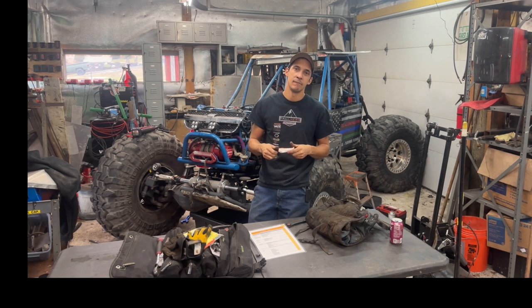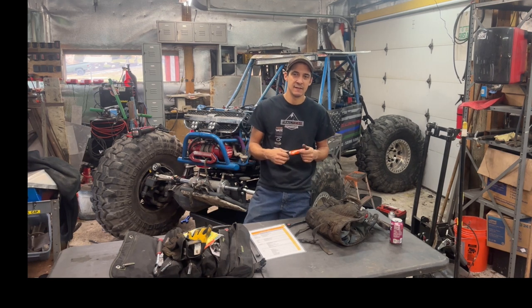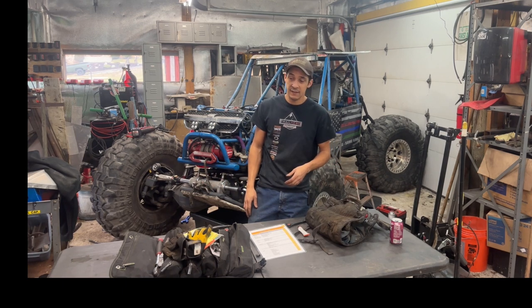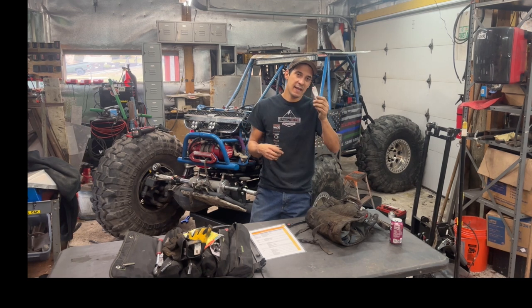The reason is, even somebody who's not into cars or off-roading will see this neon orange or green and say 'hey, those two don't line up — my bolt came loose.' I personally try not to use Loctite on everything because if I need to take it apart in the woods and I don't have a torch, it's a real pain. I mostly use blue Loctite on some stuff but mostly cross-check. The cross-check will tell you what's loose and what's staying tight. It dries like a wax — if it keeps breaking the seal on the two dots, then yeah, you should probably Loctite that.